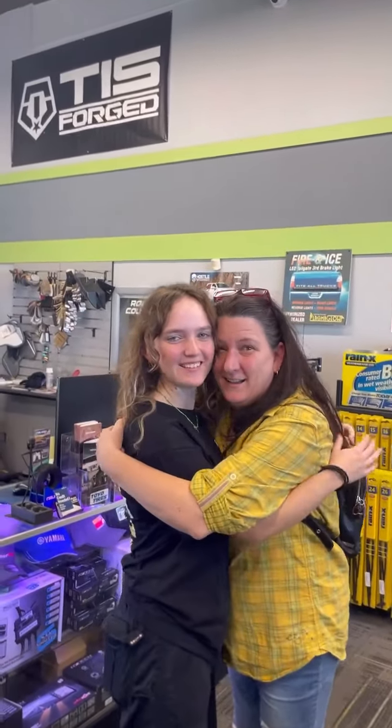Smiling? Totally fine. But really? The bolts on the plate? Four bolts on the flex plate were loose and it was rattling the flex plate. So that's why that clanking noise? It's fixed.